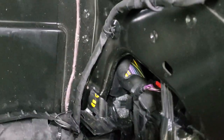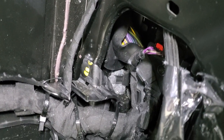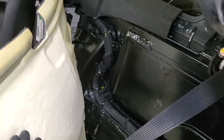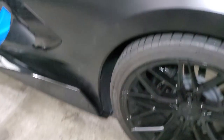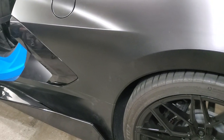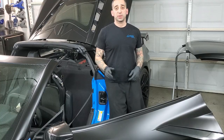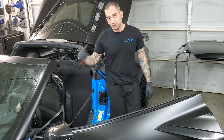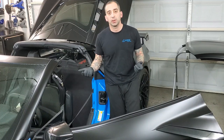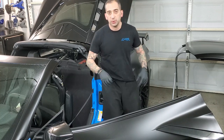There is your pass-through right there to get through. It is going to be a big rubber grommet and you can pass your wires right through there, and obviously whatever connections you need to get to, take your pick on what you want to get through via the fuse block. Once you have that passed through, you're going to have to go to the other side of the car in the wheel well, and I'm going to show you how to get to that access point. That's how you're going to pass wires through whether you're going from the passenger compartment into the engine or the other way around — depending on what you're running, just use whatever you need to do to fish it through.